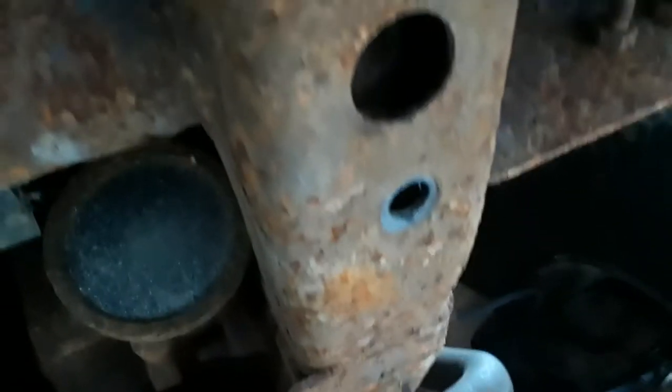So right here, the tow hook is there. Obviously we have two bolts here already loosened, and then this one right here, I'm gonna take this guy out as well. It's already been loosened, and you're gonna be looking for the hole where I pointed out on the diagram. It's right here, and I'm gonna show you how easy this is to do. I usually slide it through the hole inside of here, and then just with my finger flip it up until it gets in.